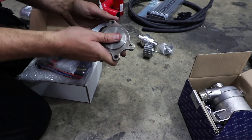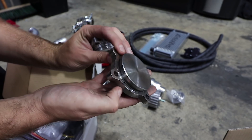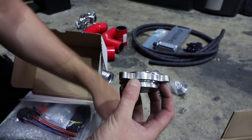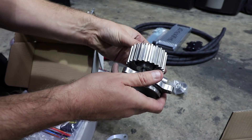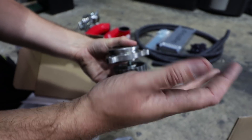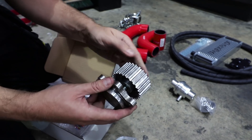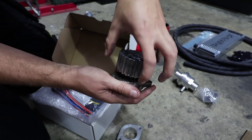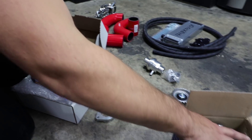Back again - these are what I forgot. We use a normal timing belt kit - this replaces the water pump. So the seal that's in the bottom end set when we build the engine for the water pump goes in there. And then this is a pulley - took some finding this one. This pulley bolts on here because the water pump is obviously normally driven by the timing belt. I had to find a pulley that had the same tooth pattern, belt pattern and width as the standard timing belt. We then had to machine this blank and offset it so that it still tensioned the belt the same - so that replaces the water pump. That's obviously the external water pump.